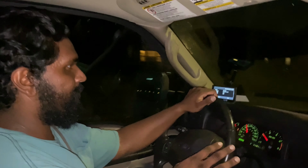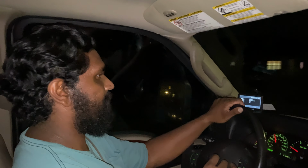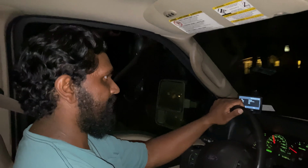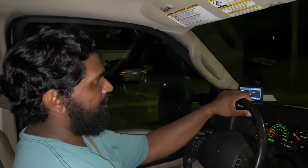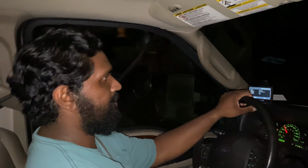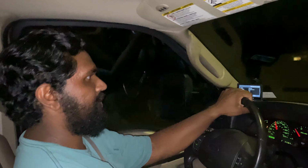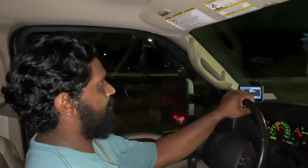And that was one thing I wanted to say yesterday when we were driving it: the shifting felt good. It felt kind of immediate, but at the same time, you could feel the tranny choose to slip just to make it softer. When you're in a tow situation or a semi-aggressive situation, you don't want the slip. You want immediate next gear catch, but obviously you don't want it to bang into the next gear. That's not comfortable. But I feel like the street tune kind of cleaned it up, got rid of that taper into the next gear, and shortened the shift pause a little bit.